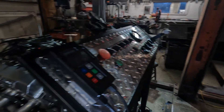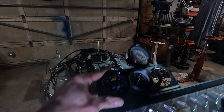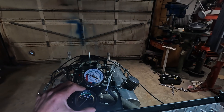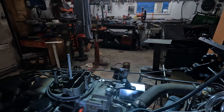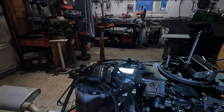I actually have an Innovate on one side and an AED air-fuel ratio gauge I was intending for my car on the other side. I also have a vac gauge hooked up, as well as another secondary one. The idea being that I can read vacuum going to my distributor, and also vacuum going to the manifold to see if there are any differences.